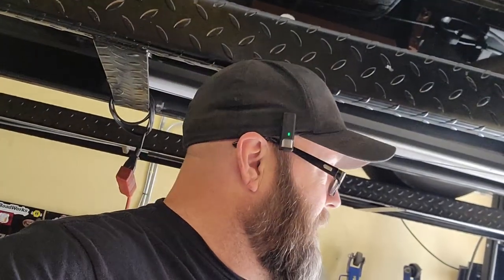I don't want to flatten out the head, and then it won't fit through the hole in the carburetor, because the hole in the carburetor is an exact fit. Really is. Once it's in there, it moves fine, but any deformation of the rod going in there is going to be not so good. So let me bend up that rod, measure and bend up that rod.